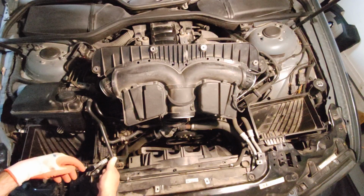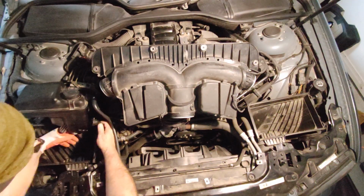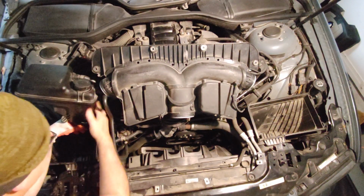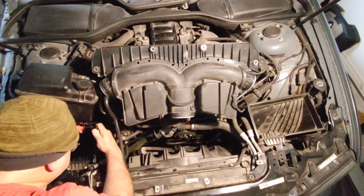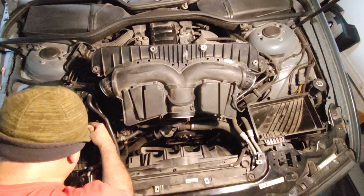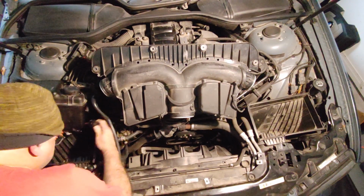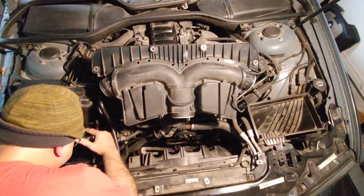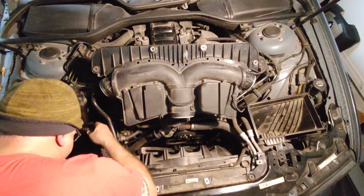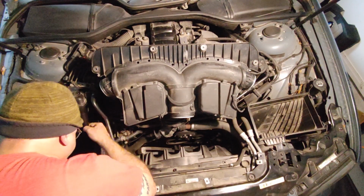So if the leak is somewhere else down, this will be the same lock mechanism. You need to remove the pipe and find the exact O-ring and replace it. So actually there's a guide here. You cannot just insert any direction you want. As I see, there is a slot here that way. So it went in, and then push the lock back.